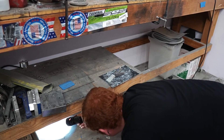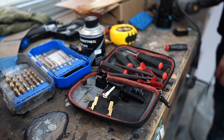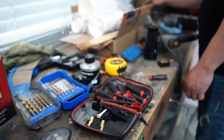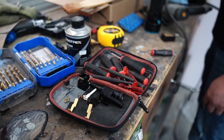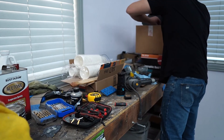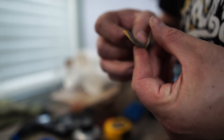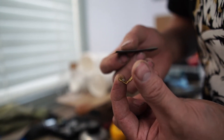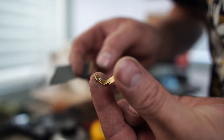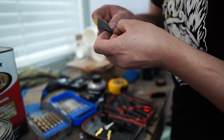One hour later — found the spring. We're going to try and clean the contacts with some sandpaper to see if that helps. I don't want to scratch it up too much so I'm going to try 1000-grit. I'm filing away just that little nub — trying to sand away the junk or whatever's stuck on it. You can see that's already looking a bit cleaner. That looks better. I really hope this works.